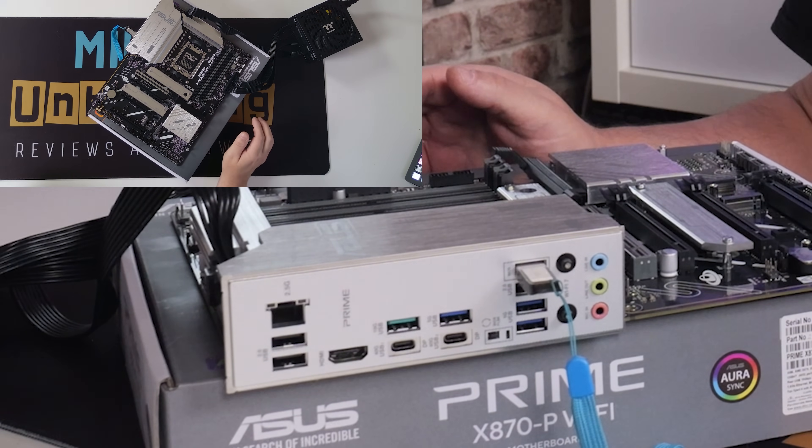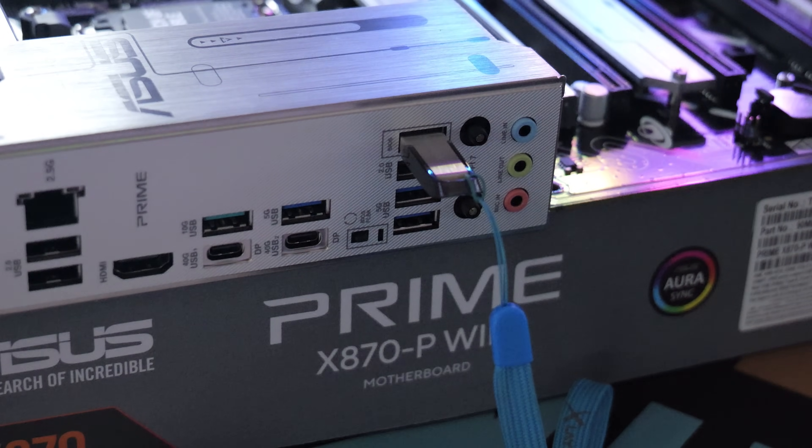Just let it go on and do its own thing — be patient. This should take somewhere in the region of about four or five minutes, so set a timer or keep an eye on your watch. If the LED flashes just for a couple of flashes then turns off, that means either the USB drive is not formatted correctly or the file is in an incorrect format. The BIOS LED will change speeds: normally it will flash a little bit slower to begin with, then when it gets into the flashing process it will go a little bit quicker, and then generally slow down towards the end. Then the system will probably click off and you may hear your power supply click off, and then it may try to reboot itself.